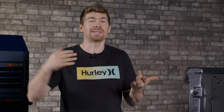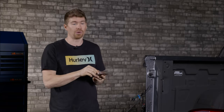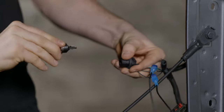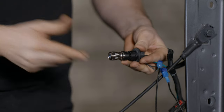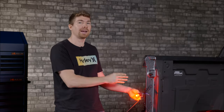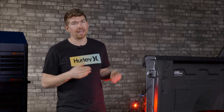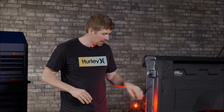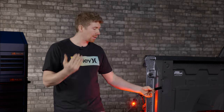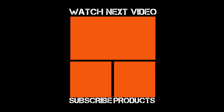If you've mounted resistors but your bulb is still hyperflashing or you're still getting error codes on your dash, if you have a Ford you might have to cycle the ignition off, plug the bulb back in, and then ignition on — that should fix it. Otherwise, depending on your bulb, it could be polarity specific, meaning you take it out, flip it 180 degrees, and push it back in. If you've done all of this, mounted your resistor properly, and you're still getting error codes and hyperflashing, occasionally you'll need a different ohm resistor. This is a 7.5 ohm resistor from Morimoto, but there is also a 6 ohm resistor — I would suggest going down if your resistance is still not good.